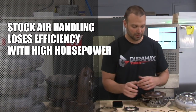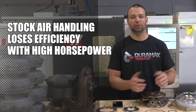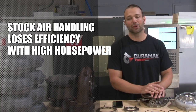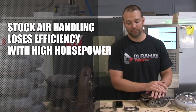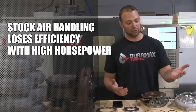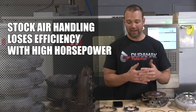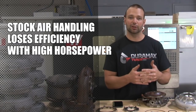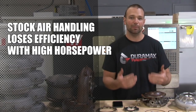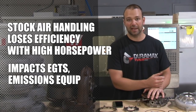Small is really the theme here. Yes, the truck moves a lot of air in stock form, but as you start to push it to that 550, 530, or 570 horsepower or more, you're going to start to see the limitations of that turbine. What we're seeing on the tuning side and the turbo side is they kind of meet up in this area of turbo inefficiency at high choke on the turbine side. That's where we're seeing those temperatures come up and where we're seeing the trucks start to fill the catalyst a little fast on those high-horsepower tunes.